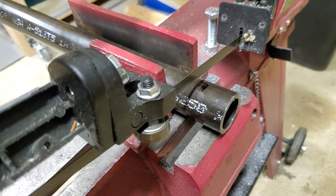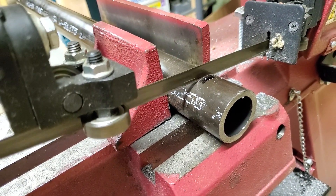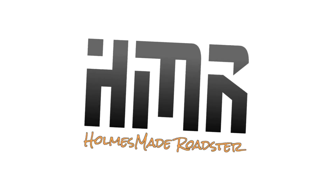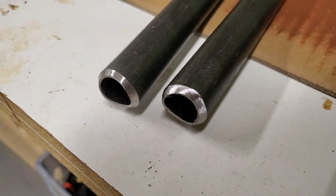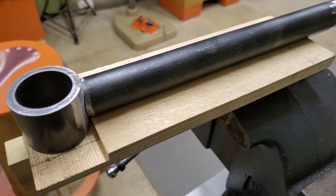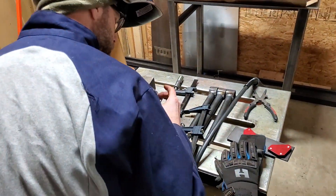Let's get to work on some car fabrication. We're starting with rear suspension components. This roadster will have a four-link trailing arm suspension with a solid rear axle from the Chevy S10. The trailing arms are 1-inch DOM tubing. The ends were notched and made up with a 1.05-inch OD by 0.188 wall DOM tube that an Energy Suspension 9107G cushion fits into. This wooden jig centers the arm on the bushing housing.